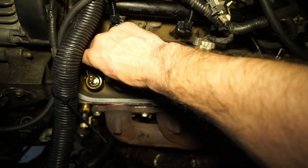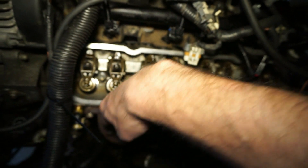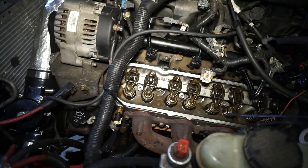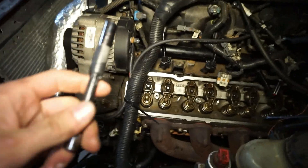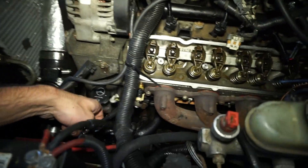One of the things — and Sloppy Mechanics Matt Happel has a video on this actually — one of the things I'm going to do first, and this was a learning that he had, was disabling the rockers. So I'm just gonna disable the rockers, basically just loosen them up so it doesn't open the intake and exhaust valves. What I'm going to be doing is sticking something in the spark plug hole and rotating the crank, then marking the balancer. I don't have the actual tool, so I'm going to improvise using a socket with an extension that is basically the same size as the spark plug hole.